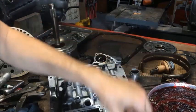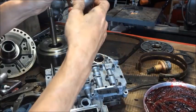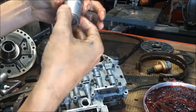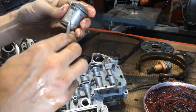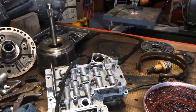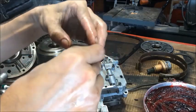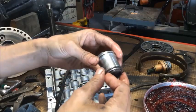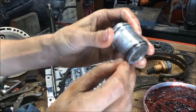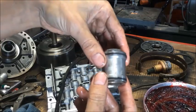We're going to go find these two seals in our kit to replace them. The seal should be exactly the same size. I'm just going to go ahead and stretch the seal over it and make sure it ends up seated correctly. If it doesn't fill in all the space, it's probably the wrong one. Let me take a second look — yes, there is still one more seal that I could have confused it with. Good, that fills in all the space — looks like the right one. And that looks like the right one as well. So those are those seals replaced fully, all the way seated.